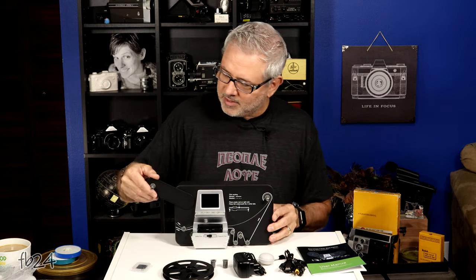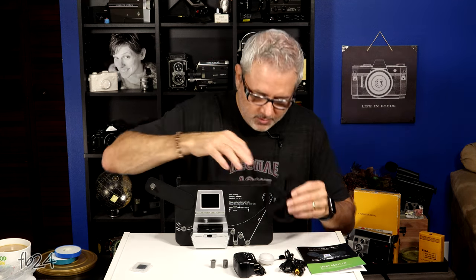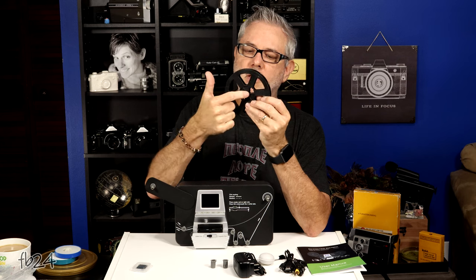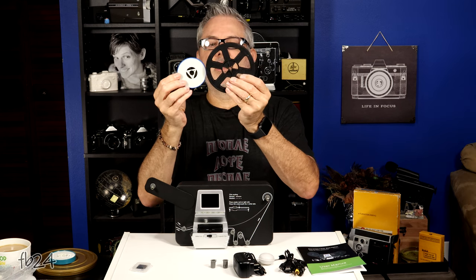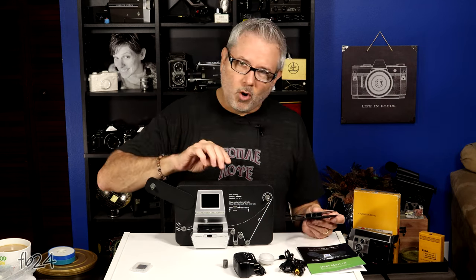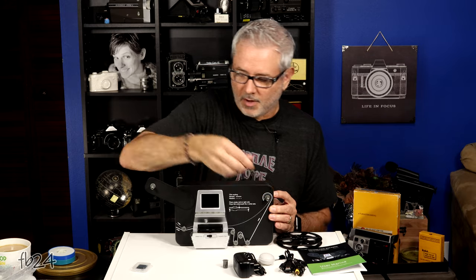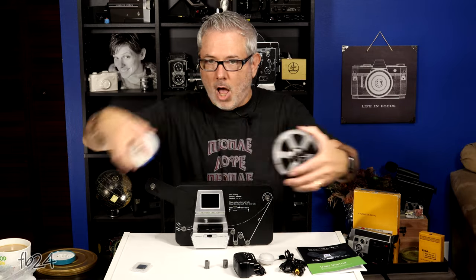This is the feed spool side — simply open it up over here and it's got good tension on it; this arm is solid metal. This is your take-up reel — snap it onto this side. Now the take-up reel is an eight millimeter spindle. Eight millimeter and super eight spindles are different; the super eight center hole is a lot bigger than the regular eight. So that's where your adapters come into play. Both spindles on the machine are set up for regular eight, but if you're using a super eight reel, you just pop one of the adapters on there — they give you two so you can use super eight on either side.